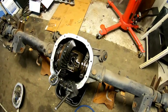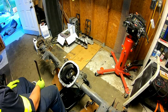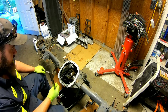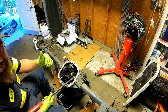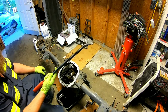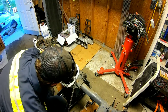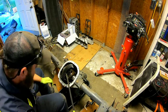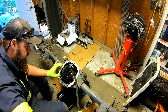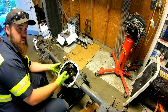I wouldn't be surprised if this ring and pinion makes noise, and perhaps the customer couldn't hear it over the exhaust, tires, or what he suspects to be a bad pinion bearing. All we can work with is what we have. Normally I figured I'd have to fight to get the carrier out because they're supposed to be tight — you're supposed to hammer with a brass or aluminum drift. These bearings and shims should go into the housing extremely tight where you need a pry bar to get underneath the ring gear bolt, working it back and forth. This right here, being able to do that, will tear up the carrier bearings all by itself.